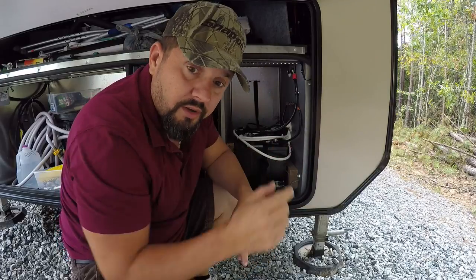Personally, if you're just an RVer going out on the weekend getaway, I would probably just stick with lead acid batteries — just regular old deep cycle batteries. Most RVs have the 12 volt house battery. Throw it away, it's garbage. Get the 6 volt golf car battery. Put two 6 volts together — you've got to buy them in pairs, two 6 volts. I'll show you.